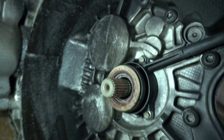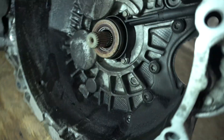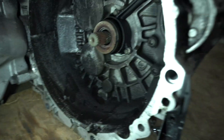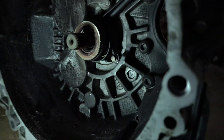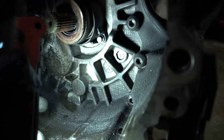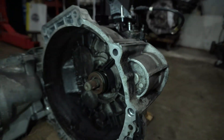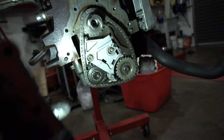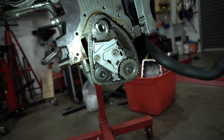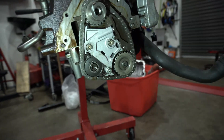Just realized — when I took the engine out I wasn't really paying attention to the transmission, but now that I look at it, it's wet in there. Now that it's been sitting for a while, we can actually see fluid, so it appears the slave cylinder is leaking. We're going to have to order a new slave. Also, I ended up getting a new balance shaft tensioner guide — the old one was messed up and got a little chewed up from having no oil.